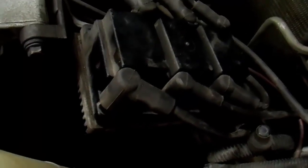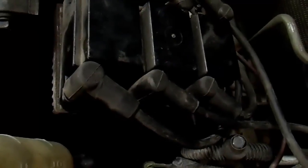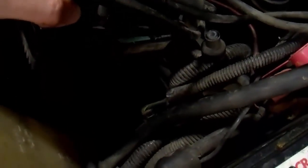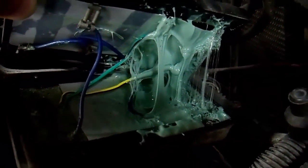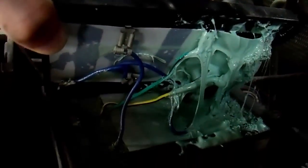Update here. I did a little bit more investigation and I found something. Here is the coil pack once again. There are six screws holding the coils onto the ignition module underneath. Some of those screws broke off rather than coming out because they've been there a long time. I hammered on this with a dead blow hammer until it finally broke loose. If I pull this up slowly, you can see what is actually underneath. They have some insulating goo which all flowed down to the bottom over time apparently. The bottom half is the ignition module; the top half are just the coils. You can see that the coils are held on with these low voltage wires. I noticed that this one was loose. I plugged it back on, started the car up, and it runs perfectly.